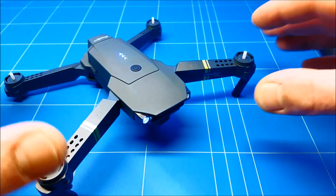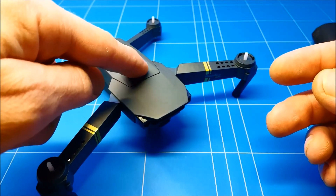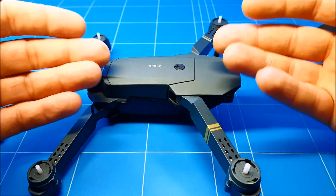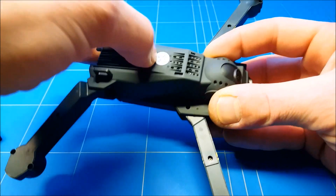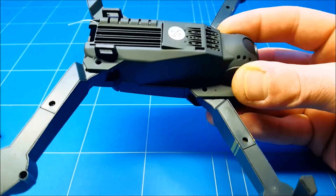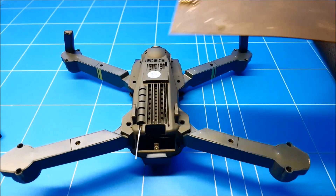Welcome back — we have disassembled all four propellers. I forgot something really important: before you do any maintenance on your drone, car, or whatever, always kill the power and remove the LiPo battery. If the props start spinning while you're trying to disassemble them, that's an easy way to hurt yourself. Always remove the power and battery to be really safe. The next step is disassembling the arms, and for that we also have to disassemble the underbelly a little bit. If you're smart, use a magnet to hold all the screws in order.